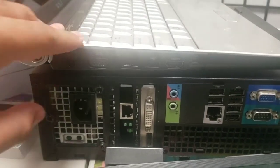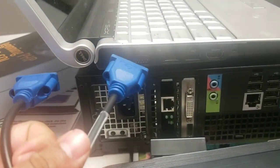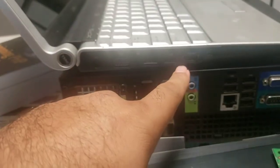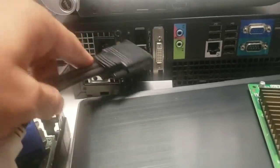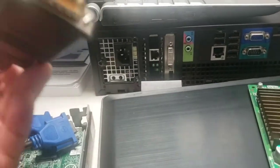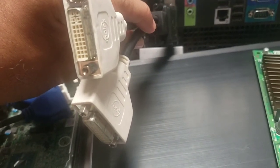In other examples, you may be using your laptop with a VGA — the blue cable like this. You can connect it here and then it goes back to your computer. You can then use another monitor with HDMI, so you can use dual monitors like this. In some cases, you may have a DVI adapter like that, and the two white cables are going to go to your two different monitors.